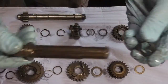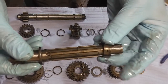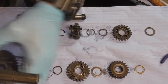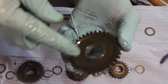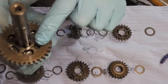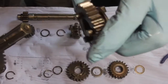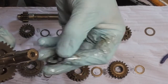Rebuilding is just going back through — give everything a good coating of oil when you put it back together because it'll help it. Our bush goes on, there's our gear. When you put this first gear on, this is on the outside. You need these cutouts. There's our spacer, first splined washer — all the way on.